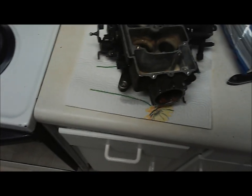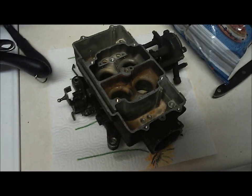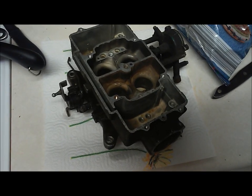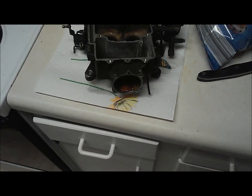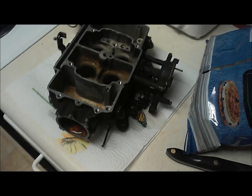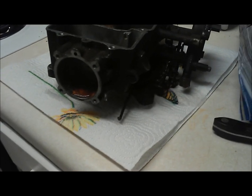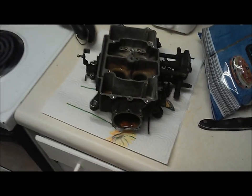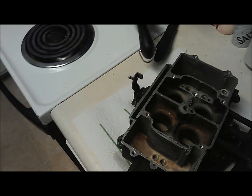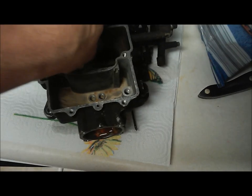Alright, we've got the heat on and our lemon water mixture is starting to churn. I'm going to go ahead and set the carburetor down in it. Notice I have it well disassembled — I definitely recommend doing this. You don't get very far with carb cleaning if you don't have all the passages open to allow the cleaner to really do its work. You also want to be sure to remove any rubber diaphragms you want to reuse. In this case the carburetor has a pretty expensive vacuum secondary assembly — about 30 bucks — and it still works, so we're going to remove that so the lemon juice doesn't mess up the rubber.